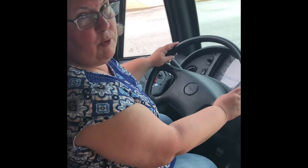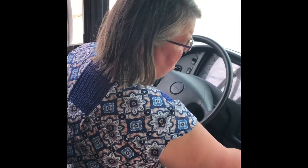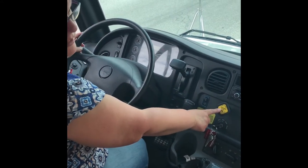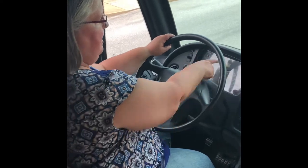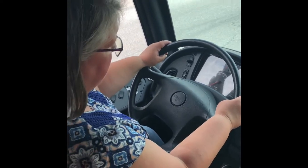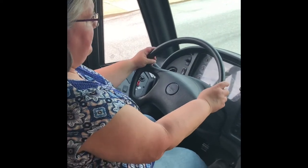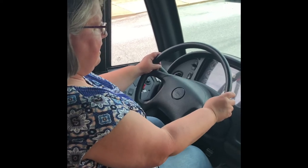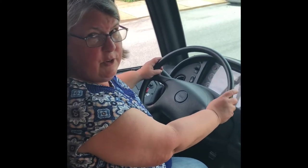The next thing we're going to do is check our brakes — listen up and you'll hear them. First, I'm going to push in my parking brake. That is what helps keep the bus in the same place when I park it. I'm going to push it — it's still working great. I'm looking at my gauge brakes and making sure that there are no leaks in my air brake system. Everything is looking good. Now I'm going to pump my brakes to get all of the air out of it. I'm going to hear a ding — there we go, that's working well. That's my alarm system. And then in just a few moments you'll see my parking brake engage — that's what it's supposed to do, and that's what I have to double check.